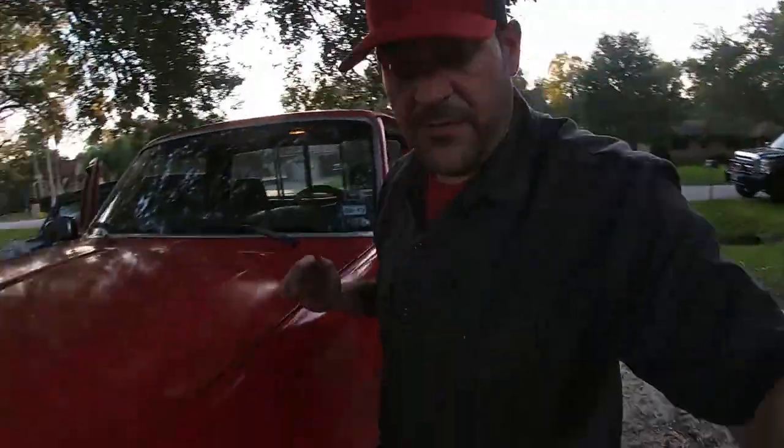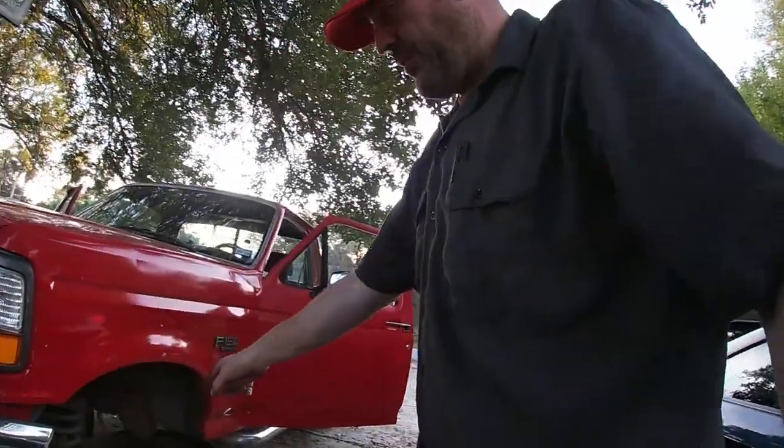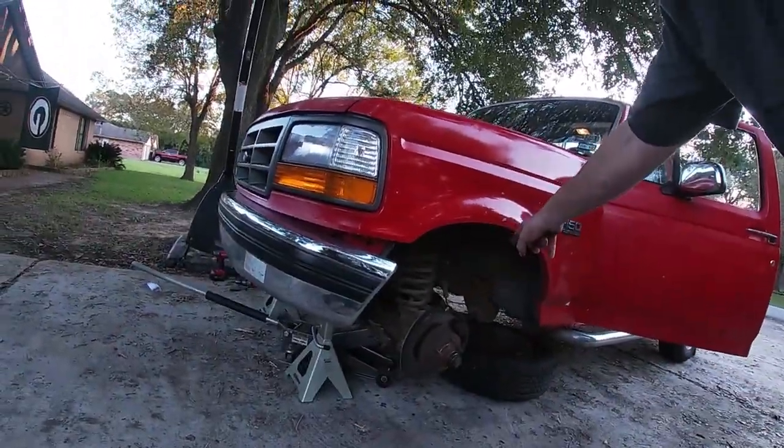A little bit different than what I've seen online, because usually these guys do it and it's just clean. Well, we kept doing it and doing it, and I couldn't see any more air. The pedal is very stiff, so I do have brake pressure in the lines. I'm gonna check to make sure the master cylinder is not low. I got some more brake fluid put in there, and basically I'm gonna do that all over again on this side, except over here we gotta pull the rotor and do the caliper as well.